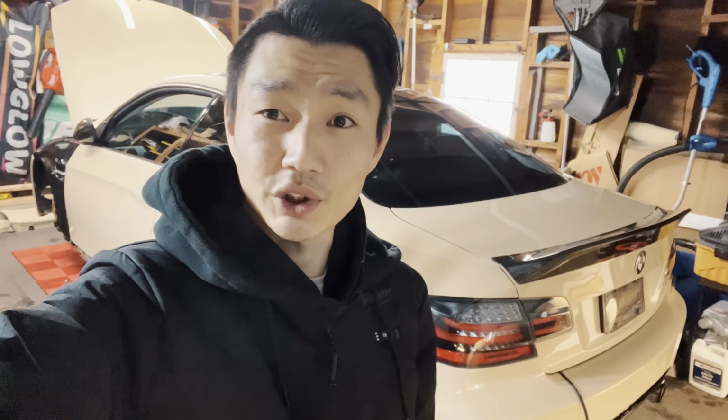I really like how there's little notches on this that go right into the fuel lid, giving you the leverage you need to remove the ring. The ring was definitely the hardest part of this entire install, but again, we did it in under an hour, and with just minor hand tools, you at home can upgrade your fuel pump. So hopefully this helps out in relieving some stress from the high pressure fuel pump, and again, it has the 750cc injectors paired with it. So hopefully we'll have plenty of fueling to get to the horsepower we're looking for.